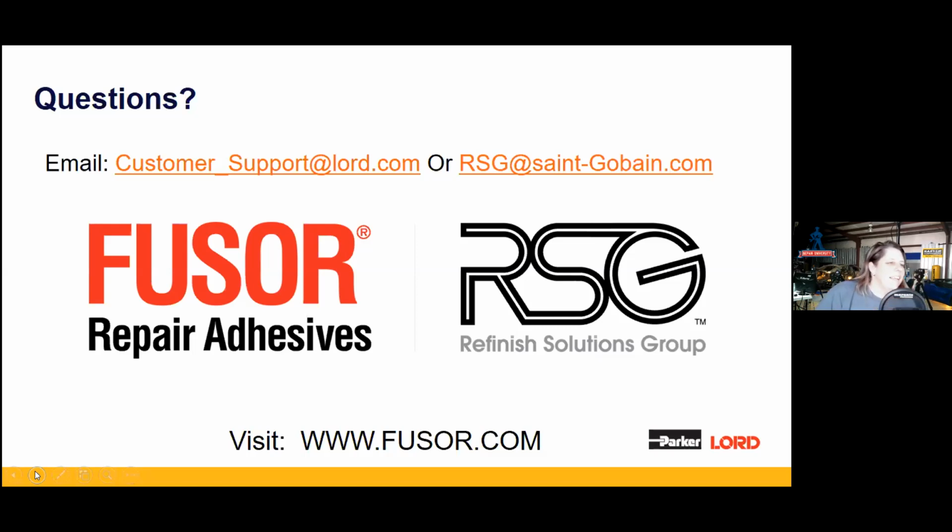So we get those gaps, and then that corrosion starts to begin around those gaps, and that's why I hate them. So when I do go out and work with shops, I tend to go, no, we're not using these. We're going to go back to epoxy, and then put something else down. You can use this over epoxy if you want to, but I know you guys see it when you're out with shops. You see that corrosive edge starting to form. Oh yeah. We created it on coupons in the lab.